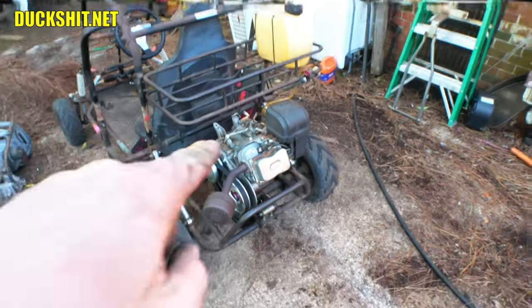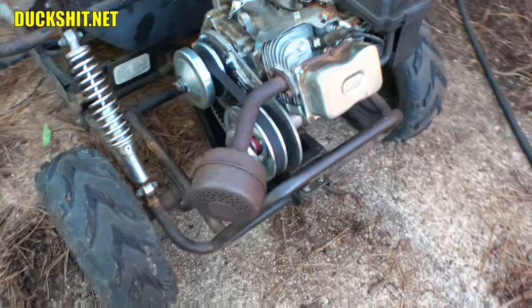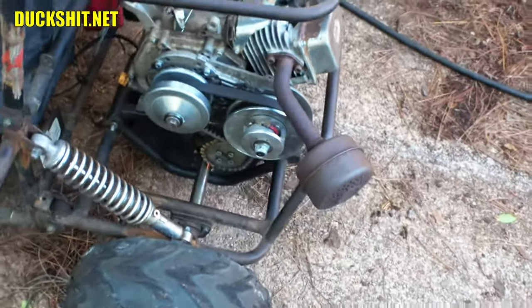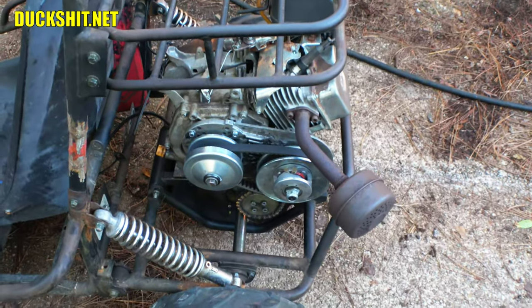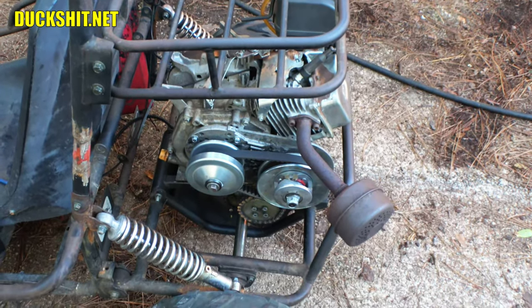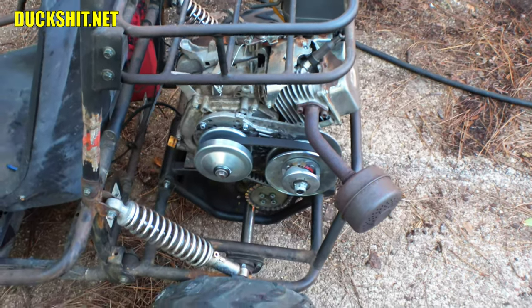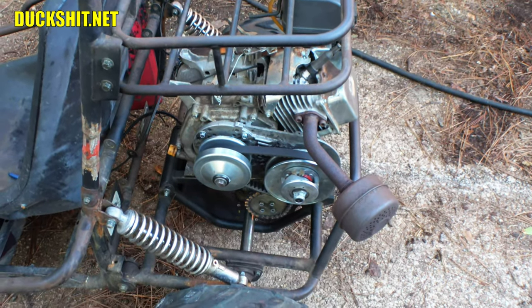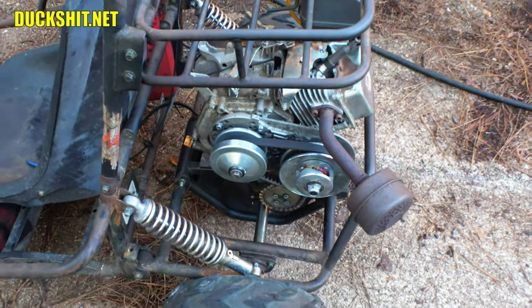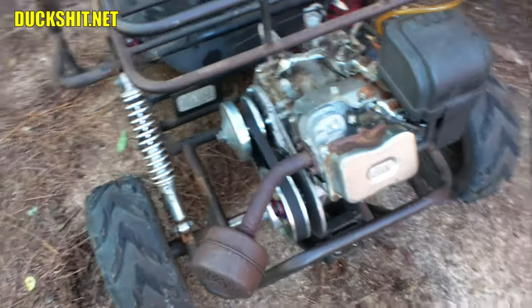We're about to do some performance work on this engine and give this thing a little more balls, which means that 30 series CVT that's on here, we're probably going to exceed the limit on it. It says the max limit's for 8 horsepower. This is an 8 horsepower engine. So yeah, we're right at the limit. So anything I do is going to push it over the top, and well, I guess we'll just see how long that lasts. If it blows the fuck up, then we'll replace it with a 40 series, which means I'm probably going to have to redo the chain and stuff and play with the alignment of things, and there's going to be a little bit of this and that that's going to go into it,